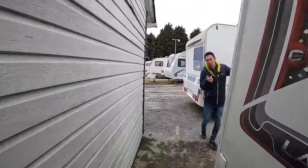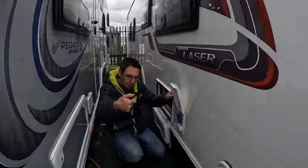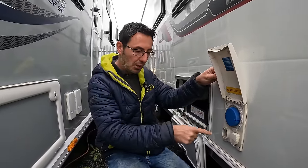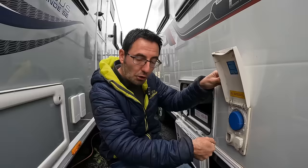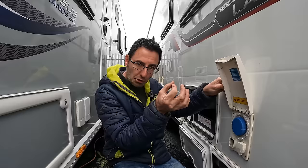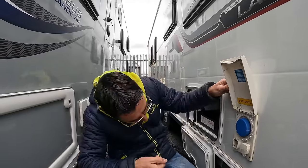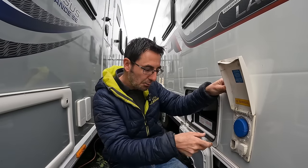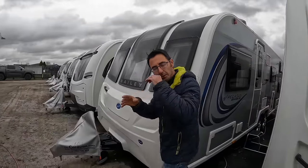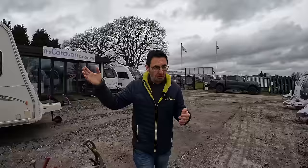When you plug your water pump into the side of the caravan, your pump itself will have two O-rings — two black O-rings. Make sure those two black O-rings are on there, otherwise it won't seal up when you plug it in; it'll just draw air in and never get the water through the system. Put a little bit of Vaseline or silicone spray on the O-rings as well — that'll help seal it up and make it easier to go in and out.